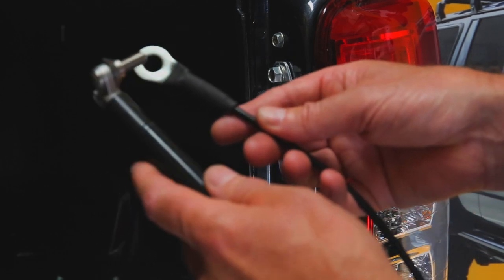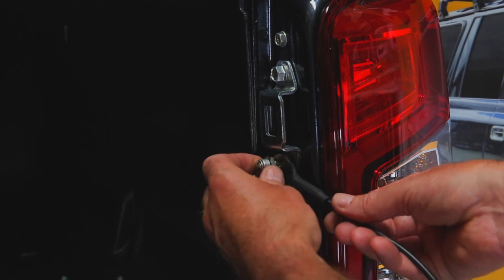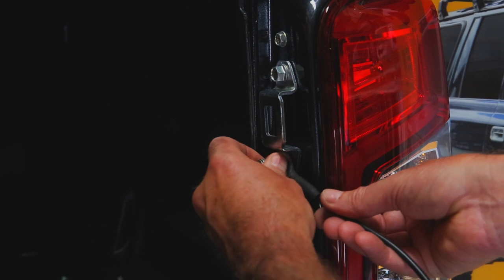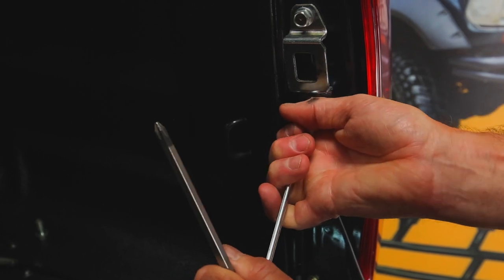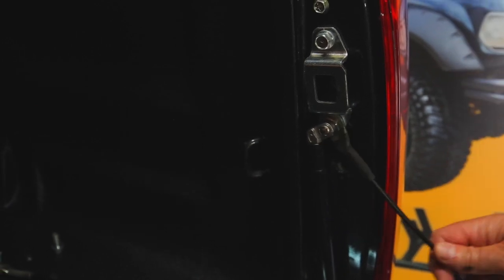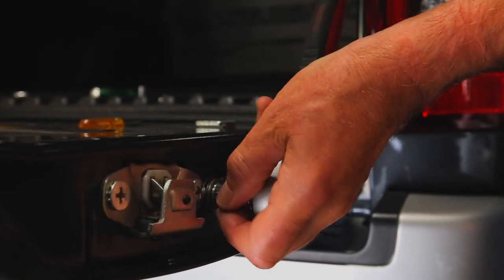Using the small hole end of the down strut cable, fit it to the lower bolt hole of the door strike bracket. Ensure when tightening that the cable is sitting on the shoulder of the bolt and the cable remains free. Ensuring the washer goes on first, attach the other end of the cable to the tailgate in the bolt hole next to the lock.